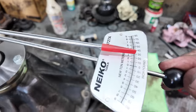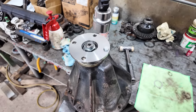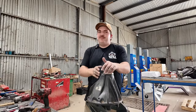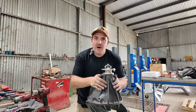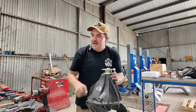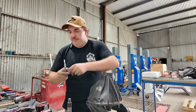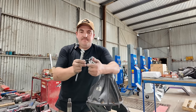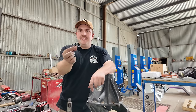Basically, you can see on the gauge it's pushing about 3 Newton-metres, with a spot around 2. There's a little bit of a stiff spot - it's a new bearing with oil in it. It's rating 3 Newton-metres and it's supposed to be between 1.3 and 1.8, so I'm going to show you how to adjust that. I'm going to take this to the press, press it back out, and try my smallest shim. I've got a 0.2, a 0.4, a 0.1, and a 0.15. I'm going to go with the 0.1 millimetre shim - that's my smallest one.